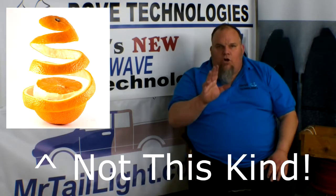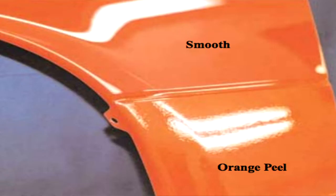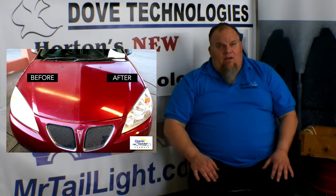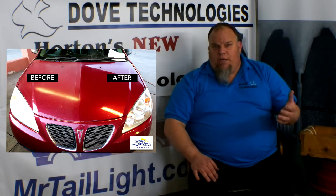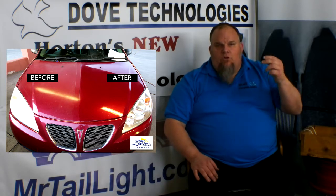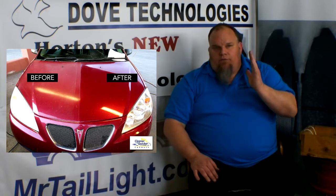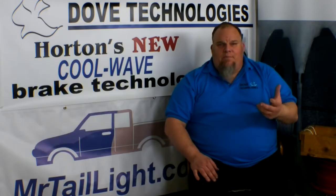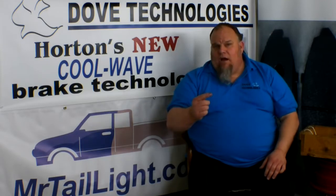Look for orange peel. Orange peel comes from the factory. If you look at your car's paint and the sun hits it, it looks like the outside of an orange — it's got a little rough texture to it. If you've got a paint job that's smoother than a baby's butt, it's probably been repainted because they don't come out of the body shop with any orange peel. They're very sleek and shiny. There's an agent added in paint at the factory to prevent fish eyes, and that's what gives it that orange peel look. So factory paint's always going to have that. If you don't have that, you've got an aftermarket paint job.